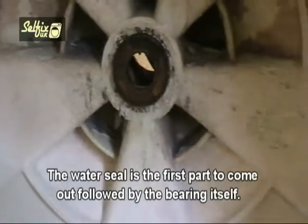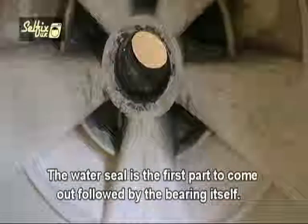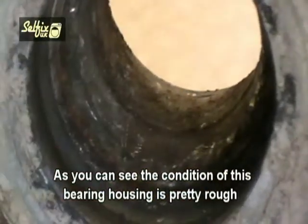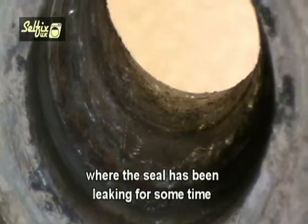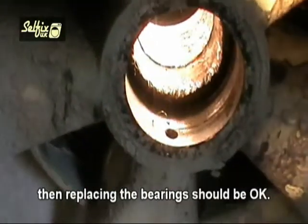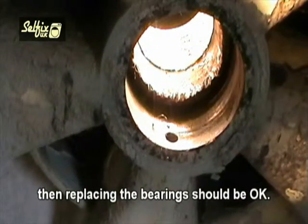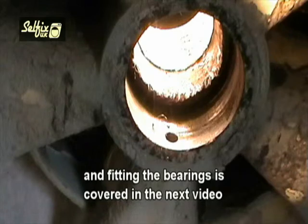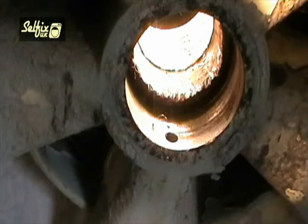The water seal is the first part to come out, followed by the bearing itself. As you can see, the condition of this bearing housing is pretty rough, where the seal has been leaking for some time, but as long as the seating for the bearing and the water seal are smooth, then replacing the bearing should be okay. Due to the time factor, we've had to split this video into 3 parts, and fitting the bearings is covered in the next video.